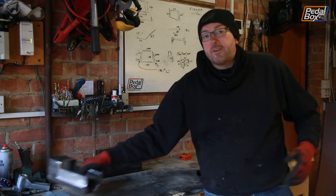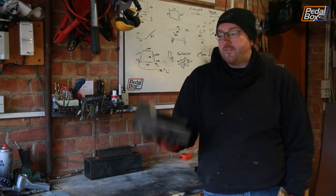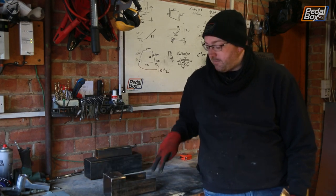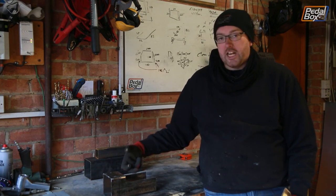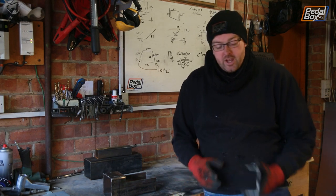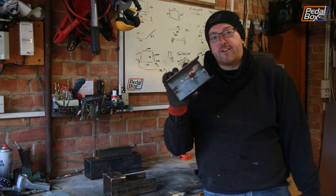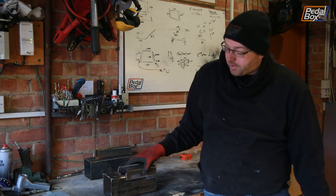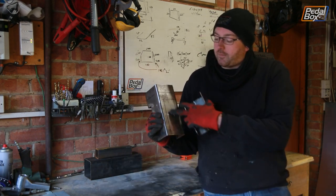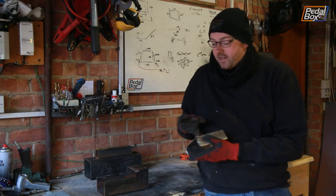Fortunately, though, we have a couple of very weird pieces. We have this one, which has already had a big section cut out of it, but is still the right length and is almost the right height at 100 by 100, because we need a minimum 80mm clearance in the middle, and we need to clear 120mm across the top so that we can clear the bend on the top pipe. This is some 2-inch by 2-inch box that I'd sectioned in half. So we've welded this back together, and this becomes a perfect extension that sits on the top. So now all we need to do is cut a slot out the bottom, which you can see I've already marked. This will slide down into the back.